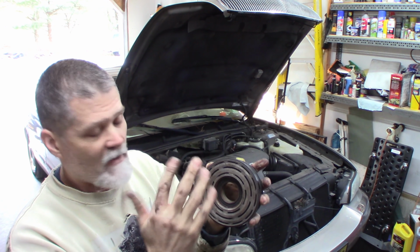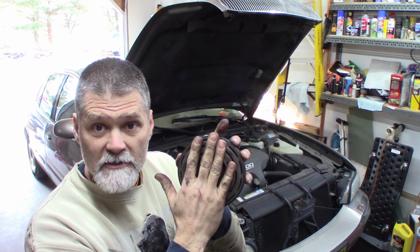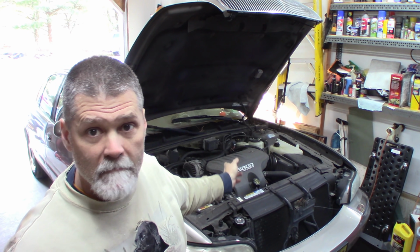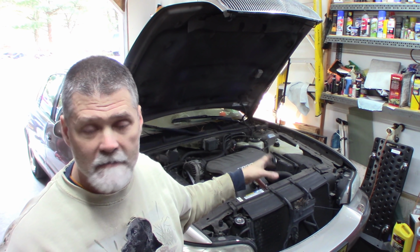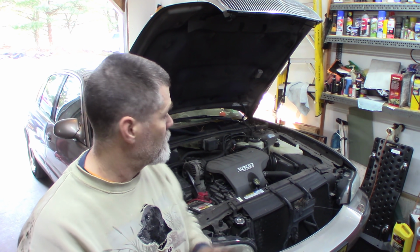Then it's just a matter of pressing the actual clutch on there, setting the air gap at 30 thousandths for this car. I set it at 30. I did run it. No horrendous noise when it's not on now, which is good. And I turned the AC on, and the clutch engaged, and it worked fine.